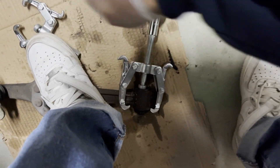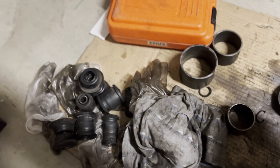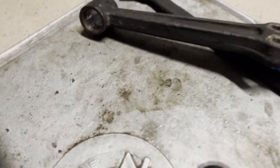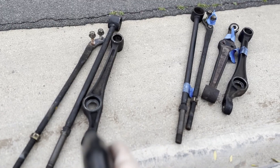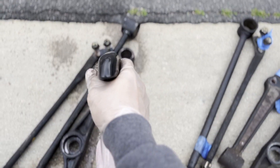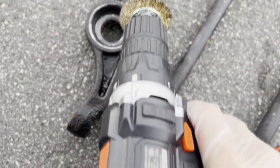You can see here I'm hand-pressing out all these old rubber bushings, and we're going to be putting in some poly bushings. I did this on my other car and I always like to do this. I was driving on this and cringing so hard — the suspension's been so blown. Everything's out, old ball joints pressed out, new ones going in as well. This is purple power to help get off the dirt and grime, then after this I just grind away all the rust and surface debris.